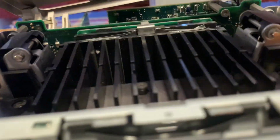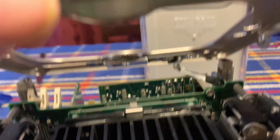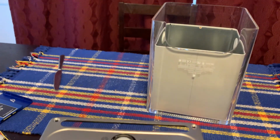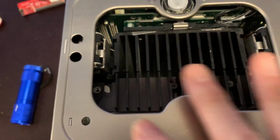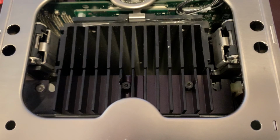This just comes up. Now you can see where that cord is for the power button. I'm going to put this back down so I can disconnect that without damage. Okay, the first glitch of the process. The Apple repair manual did not indicate that you need to remove this top shield or unplug the power button in order to do this process. So I have left it on, at least for now, although it is still unscrewed.